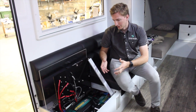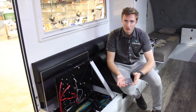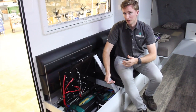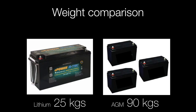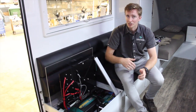The last part of our SportsCruiser system is the 200 amp hour lithium battery. We also have 125 and 100 amp hour options, but in most caravan situations the 200 is by far the best choice — it gives you the most variety of use and the largest storage capacity. This 200 amp hour lithium is equivalent to 300 amp hour AGM batteries. When you think about the weight saving, you're looking at 30 kilos per AGM battery compared to only 25 kilos for this lithium, so you're saving significant weight, increasing storage, and charging at a much faster rate.